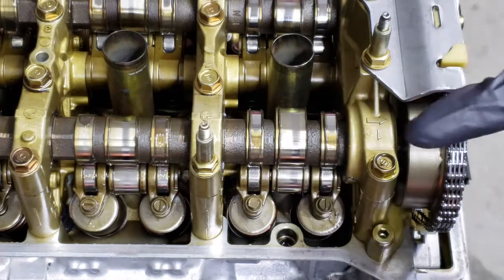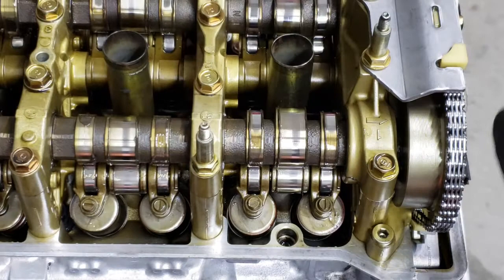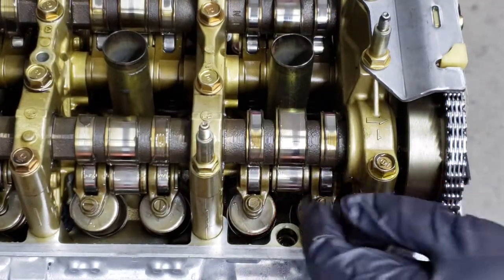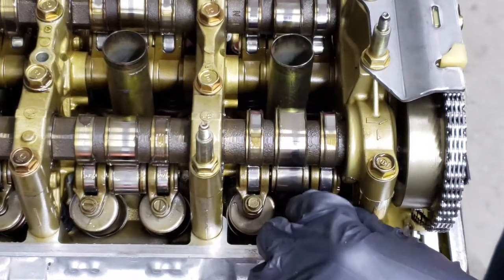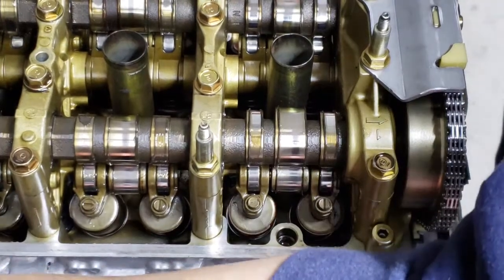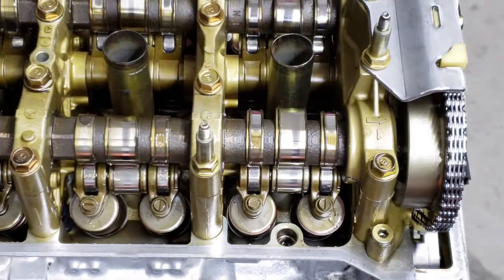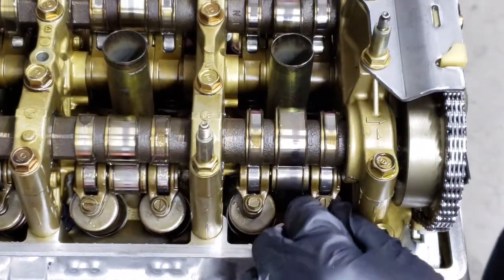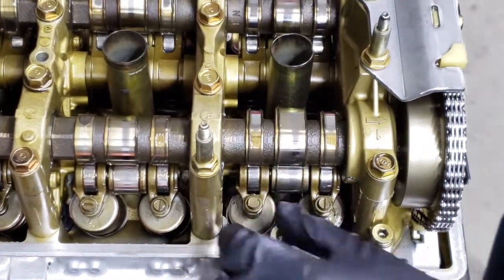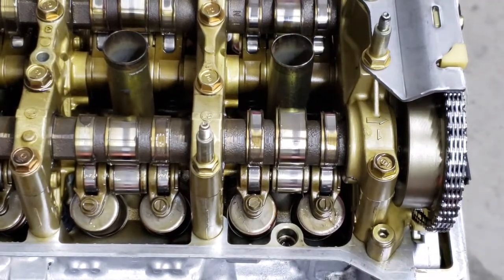What you're going to need is obviously the feeler gauges, a 10mm wrench, and a flathead screwdriver. They make a fancy tool for this, but it's not needed. Before you do a valve adjust, you want to put that particular cylinder to TDC. We're doing cylinder one — I already showed you how to get to TDC on cylinder one. You just want to make sure these are loose here. So the first thing I was going to do is check the spec on it.